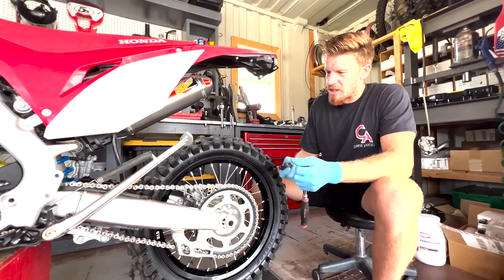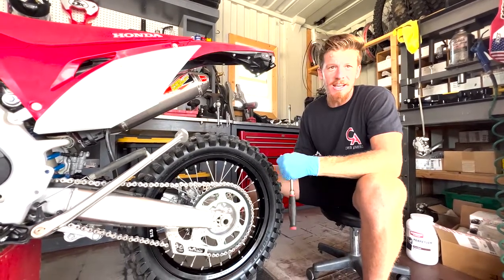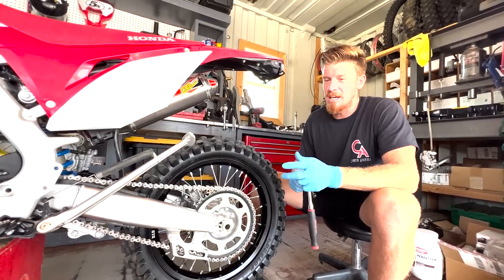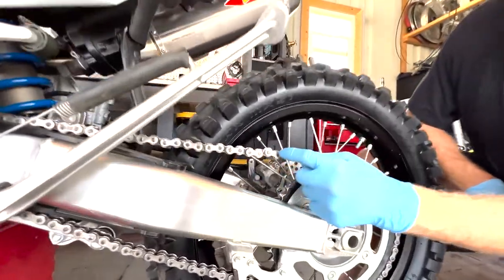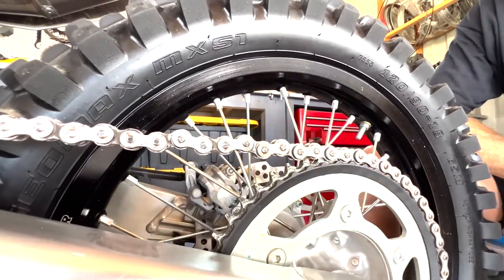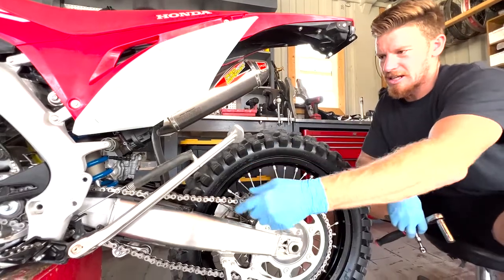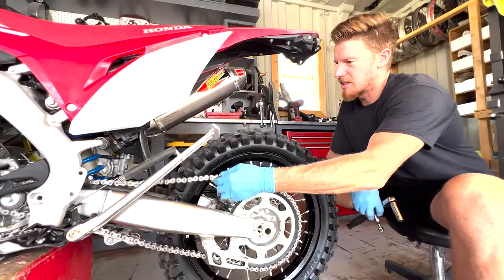To begin, step one is removal of your chain. This chain — it's an RK chain — comes stock on a 450L. It's good for maybe 2,000 miles. Here are some symptoms of a worn chain: stiff links like this mean the lube is basically gone. It's very hard to bring back a chain that has stiff links — it eventually rolls really terribly as you're riding. So you want to get this chain off.